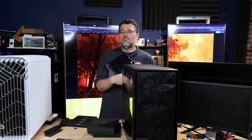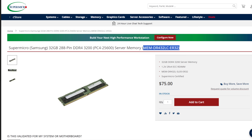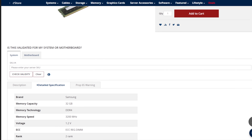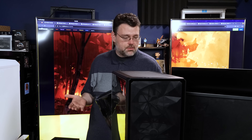Most of the time when you buy server memory, you just have a really complicated part number and you buy the same part number and it doesn't matter — they could have been manufactured at different times. The memory timings are looser. But as long as it's from the same vendor and the same actual part number, you generally are not going to have a problem in server land. In desktop land, that's not really true.